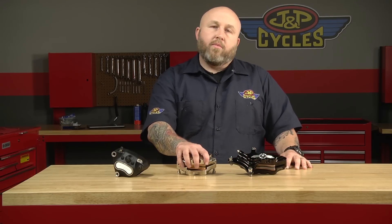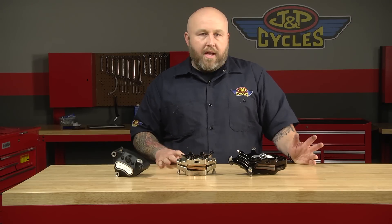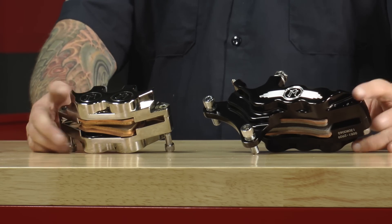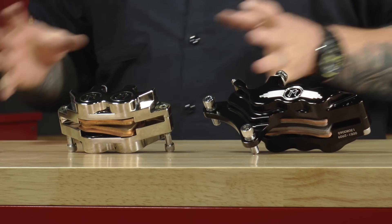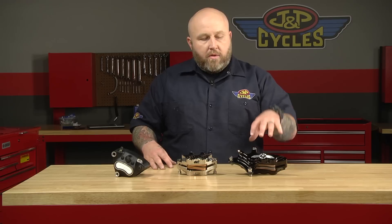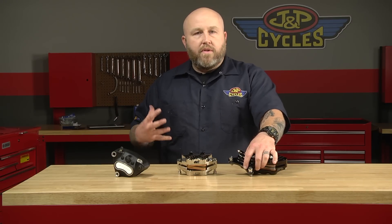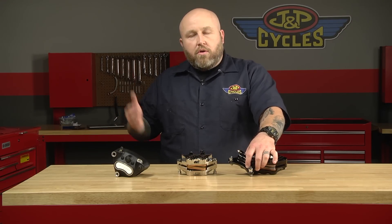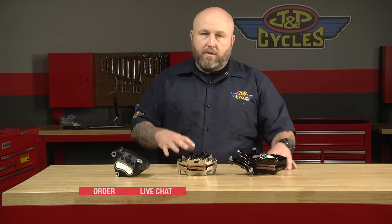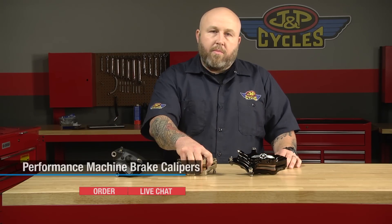Most people, if you're going to spend the money and upgrade your brakes, get a set of braided lines too — it's a no-brainer. For what you're investing here, you've got to take lines off your bike already. Get yourself a nice set of Kevlar or braided lines, because you don't want to have paid money at the bottom of your braking system to have this really awesome caliper and then skimp on the lines. You have those stock spongy lines and this really awesome caliper at the bottom of it — you're not doing the caliper justice. So if you do decide to go ahead and upgrade your braking system, do the lines too — you won't regret it.